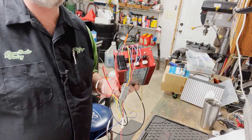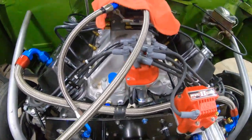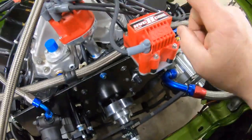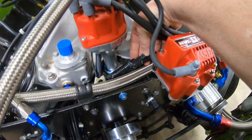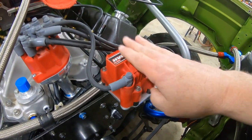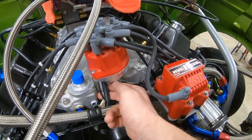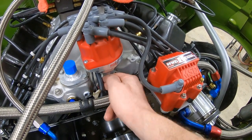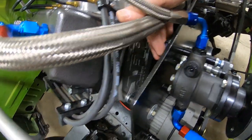Next video we will get them going. So we're over here at the truck getting ready to drop the ignition in and finish the wiring on it. This is my coil - I did a quick little harness here that goes to the connector here, so if I need to take this off it's an easy replace. I've got my distributor here - eventually this is going to go to a crank trigger but for now this is what it is. I've got my connector going right there and then I ran my harness right down through there, under that bolt, and then down through the frame.